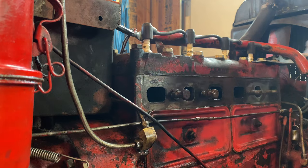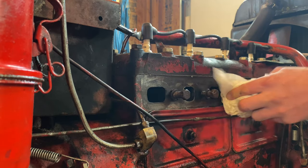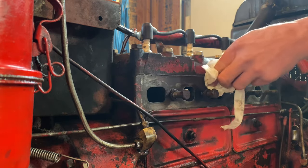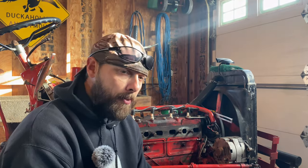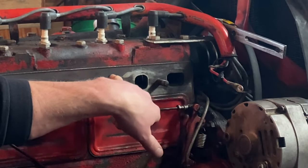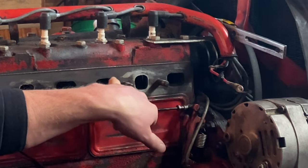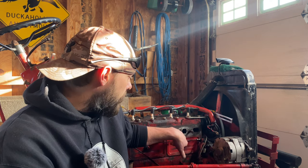After several rounds of brake cleaner, I'm going to wipe it all off with a paper towel and try to get that surface as clean as I can. Now this raises a question — I know that I have pitting on number four here, but I also noticed some other imperfections on some of the other ones where I haven't really detected a leak, but there's definitely some pitting going on. So I'm thinking I'm going to apply the high-temp liquid steel basically everywhere that I think I need to, where the gasket is, to hopefully repair all of those spots.